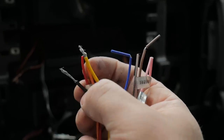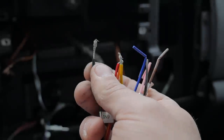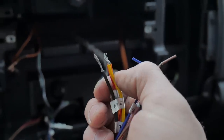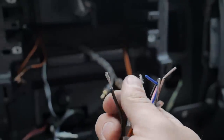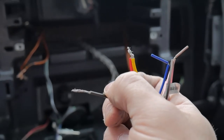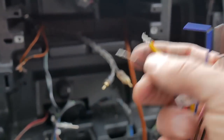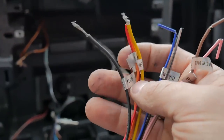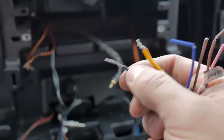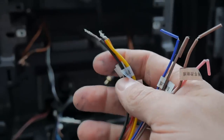What I do is I just strip the wire, twist them together, and then use electrical tape to make sure everything is sealed so the wires don't touch each other and short everything out. I don't butt connect or solder them because it's going to be a lot harder to remove when I want to swap out the radio. I've been doing this — twisting and taping — for years. As long as you apply the electrical tape right and cover all the bare wires, you're good to go.